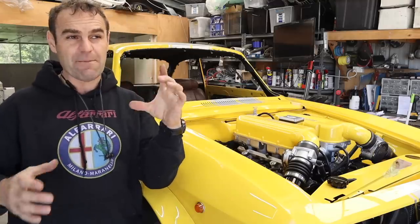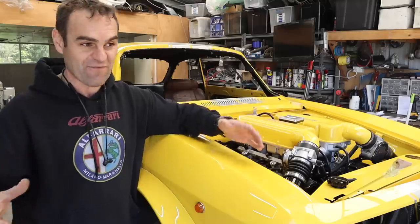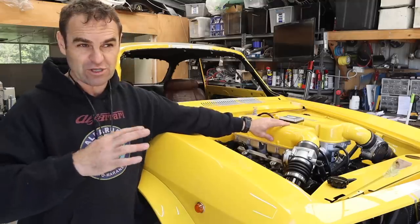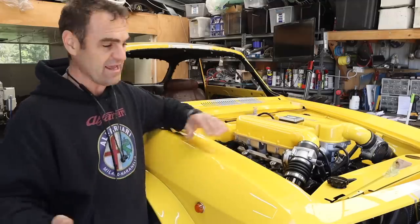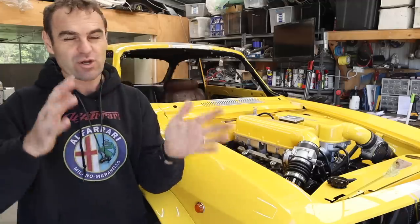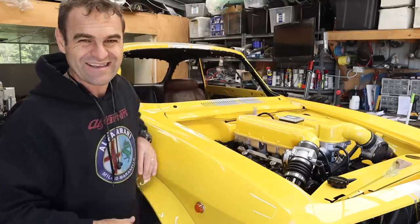Other comments about the controller for the fans and the water pump. Now, yes, I could have used the ECU to do it, but on this ECU I've actually used up all of the outputs. Because it's a V8, often you can use extra injector outputs as extra outputs, but there's only 8 injector outputs, there's 8 coils, so I've used all of those signals already, and with the dash gauges and a few of the other things that I've got planned, I probably could have tried to shuffle things around, but it was just easier to use the standalone controller. That will work fine, that will do its job. The ECU is still going to get a water temperature signal, but it doesn't need to control that system. That can be done by the controller, and that will keep things happy.